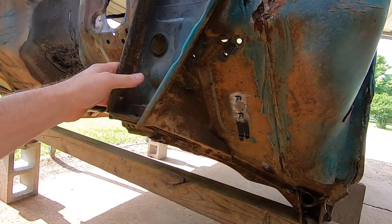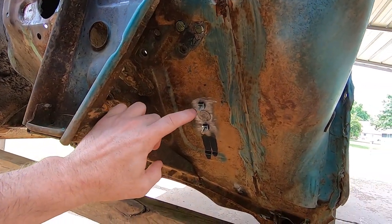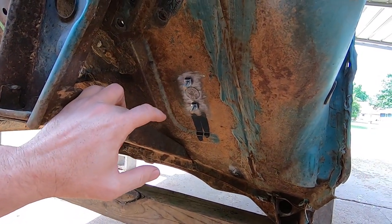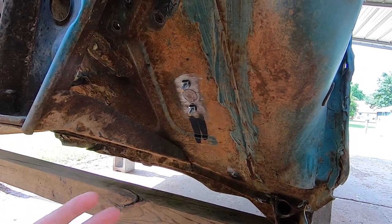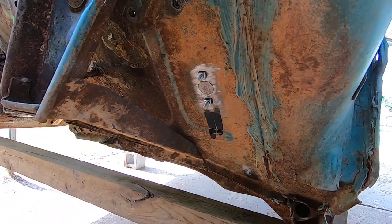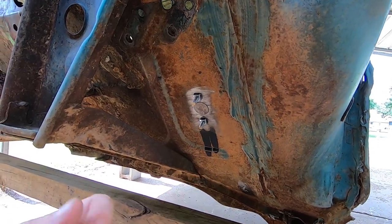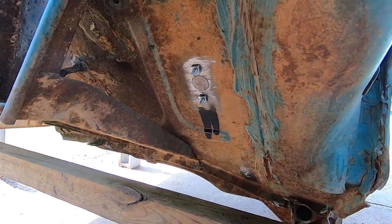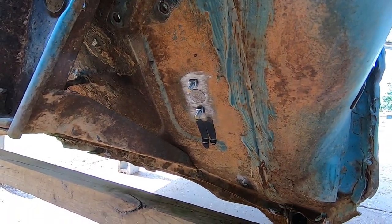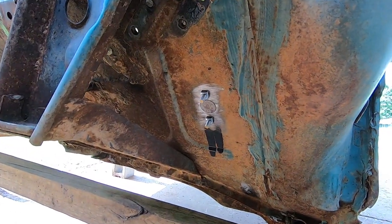This is something I've done a few times to my 55s in the past. I always change my dimmer switch out — basically tell them at the parts store 1972 Chevy pickup. It gets rid of the factory 55 one which mounts from out here and the wiring is also out here. If you've ever taken one of these cars apart, you'll notice that the three screws and the ring terminals and all that's always rusty, corroded, nasty mess. So I like to make sure that the wiring and all that stuff is inside the car.